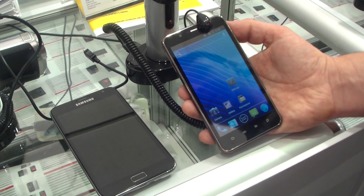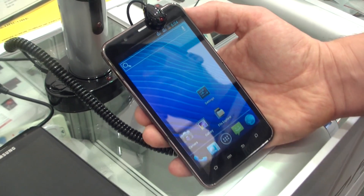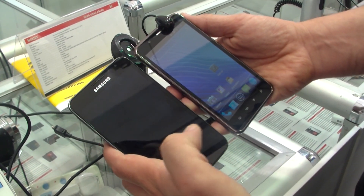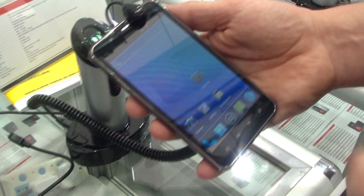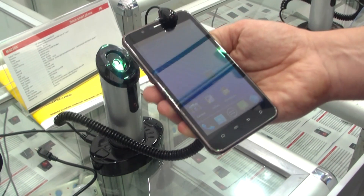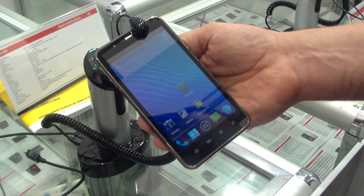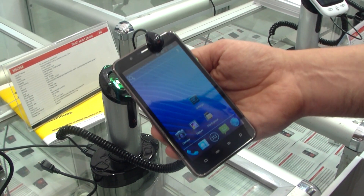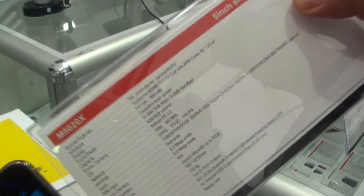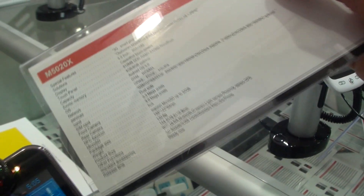That's pretty unusual for the Chinese guys because they're mostly using their own chipsets from like AllWinner, Rockchip and whatever. But this is actually Qualcomm and this one's special because it looks kind of like a Galaxy Note but it's actually different because it's only a 5-inch display. It's got 800x480 WVGA resolution, 512MB of RAM and 512MB of flash on board, but they can actually put in 4 or 8 gigs of flash. The special thing about this is actually a dual-core Qualcomm chip running at 1.2 gigahertz, same as in the Huawei MediaPad.